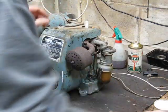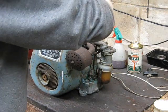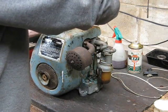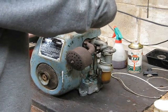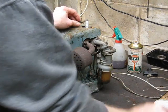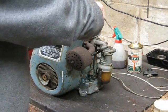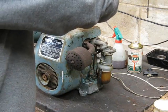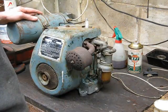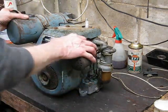Over top with the spark plugs, you've only just got to nip them up. Put it back together. Yeah, see, that's sticky on that. The screw down is half stripped out, so I'll put on the one that came with the plug. I have got some old style ones in the shelves, I'll get one of those out later and put one on that matches. So, plug's right, oil's right, got spark, look in the fuel can.